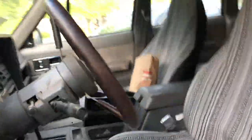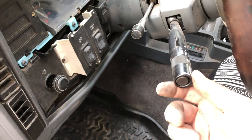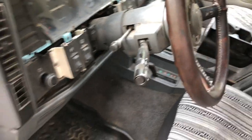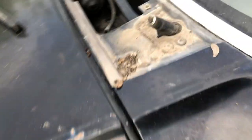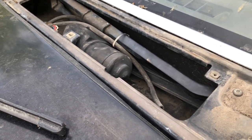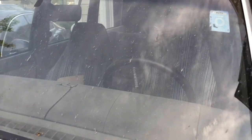I think I have some connection issues in the console because the delay doesn't work on the wipers, and there are some other little things that indicate a bad connection in there — I'll have to tear that apart another time. What I really wanted to test right now was that there was proper clearance, and it seems there was. Let me get the cowl back on, then the wipers, and then we'll officially test the full sweep function.